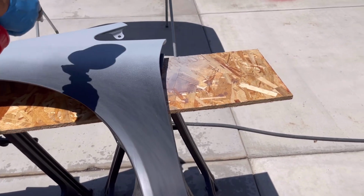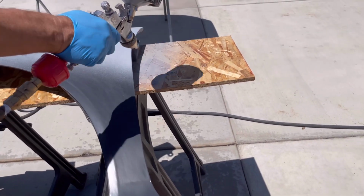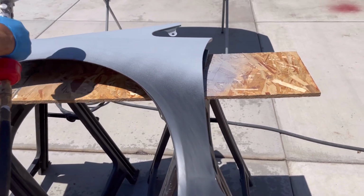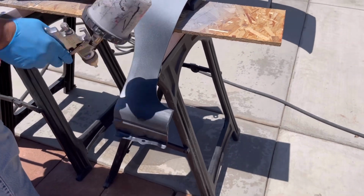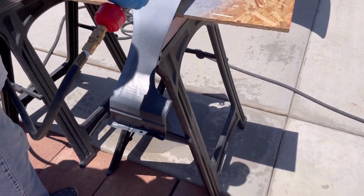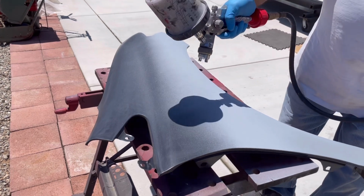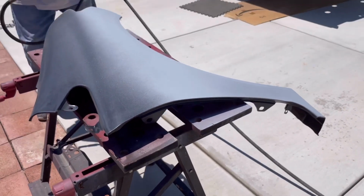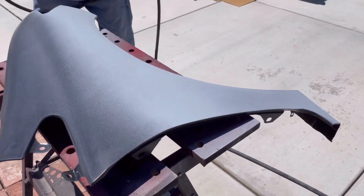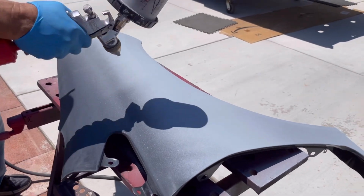And I would also improve my air filtration system from my air compressor to trap any moisture. The air compressor creates moisture. That moisture passes through your gun, and then it causes a lot of problems with your spray pattern, which more so creates like an orange peel. So a good quality air dryer filter would also help improve the appearance and the quality of the work that you're spraying.